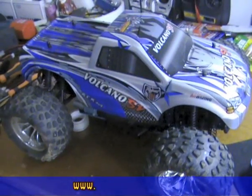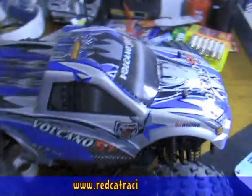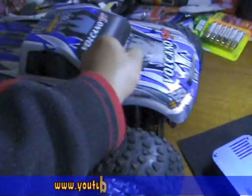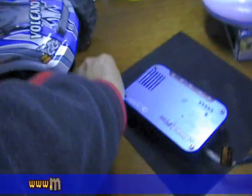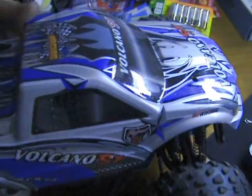Hi, this is Alishanmel, and I'm going to answer a very common question that I receive almost every two days from my users. They say, right after we start the truck or Nitro RC car, it starts to rev very high and wants to take off. Well, the problem is very simple — your carb is open more than it is supposed to.